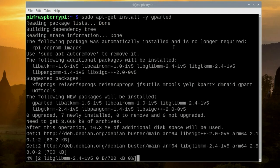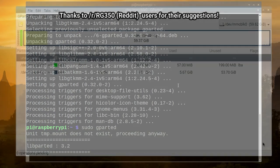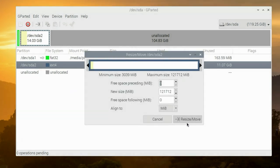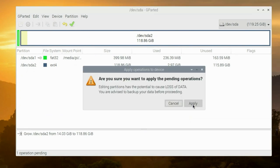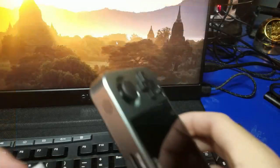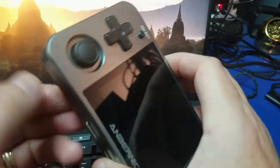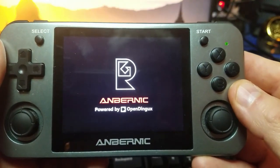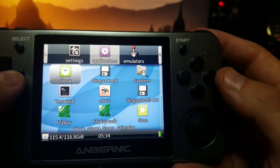Once the image has been saved, you won't be able to take advantage of the extra space on that microSD card unless you expand the partition. I'm going to use a Raspberry Pi 4 with GParted to expand the partition — though you don't have to use a Raspberry Pi; there are a couple of options on the Tips page. Select the microSD, then the partition, EXT4, resize it, and click Apply. Once complete, you'll have full access to the entire size of the microSD. Then just plug it into the RG350M, turn it on, and it should boot up normally. Be sure to keep your original firmware microSD card safe so you can always revert back.